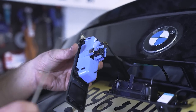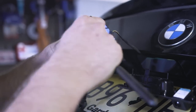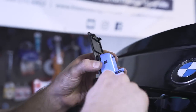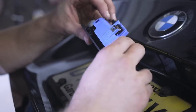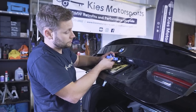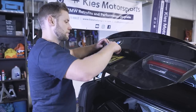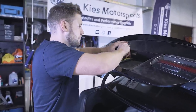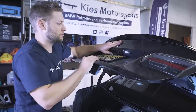What we need to do is take this blue piece, take it off, and transfer it onto our new handle. To do this, I'm going to use a pick tool to start releasing these tabs on each side. Then you're going to take this handle and clip it on just like that — you want to test it to make sure you hear an audible click. The switch works great. You're going to take your wire, stick it through this little hole, then take your camera, line it up, and snap it right into place. Looks like it came from the factory.